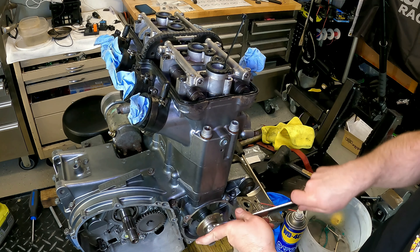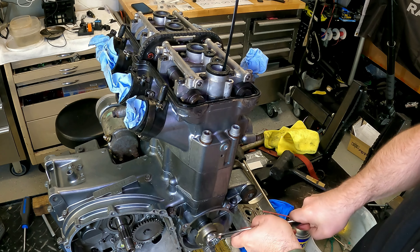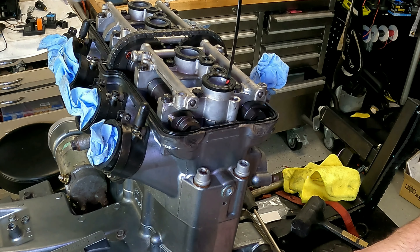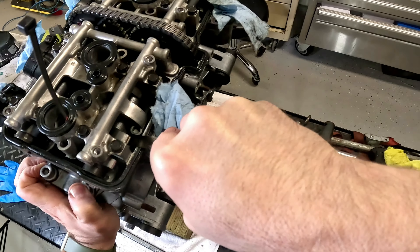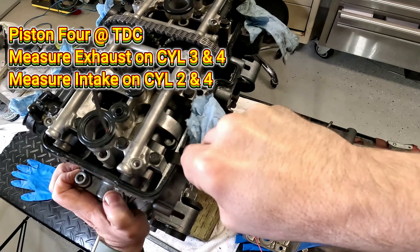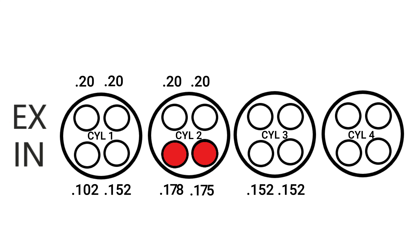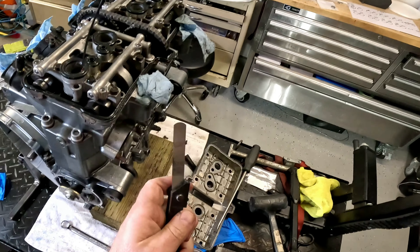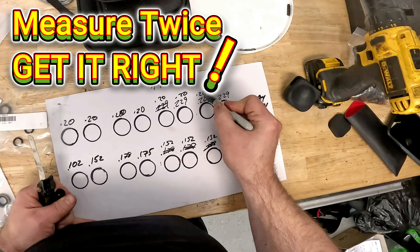With these eight valves done, I now need to rotate the engine over until cylinder number four is at top dead center on the compression stroke. I'm using that cable tie again, this time in cylinder number four, to make sure I get it to the top of the stroke. Confirming all this with the timing marks, and those cam lobes on cylinder number four are now roughly 90 degrees from the valves, with the exhaust valve about to open next if I continue to rotate the engine crankshaft. With cylinder number four at top dead center, I can now measure the gap on the intake valves on cylinders two and four, and the exhaust valves on cylinders three and four. I can't stress enough how important it is to get accurate measurements here, since everything about doing this job correctly hinges on knowing the true gap of the valve bucket to camshaft.